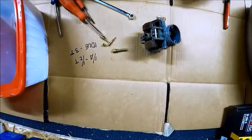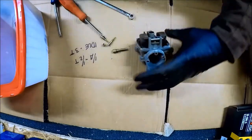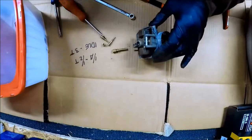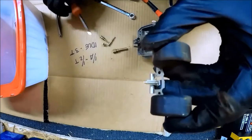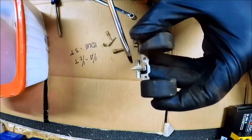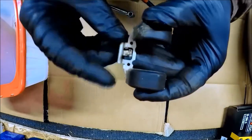Back in the old days you'd have to soak this stuff in parts cleaner and carb cleaner, get little strands of wire and run them through all those holes, and it took hours. Ultrasonic cleaners have made a big difference. I'm going to pop this float out. This needle should only come out one way — actually you can push this needle out either way. My eyesight isn't what it used to be. I remember these being a rubber tip, and if you saw a line on it you knew it was kind of worn out. This one looks like a metal tip — I think I can see a little wear line on here, so I'm probably going to have to replace this needle.